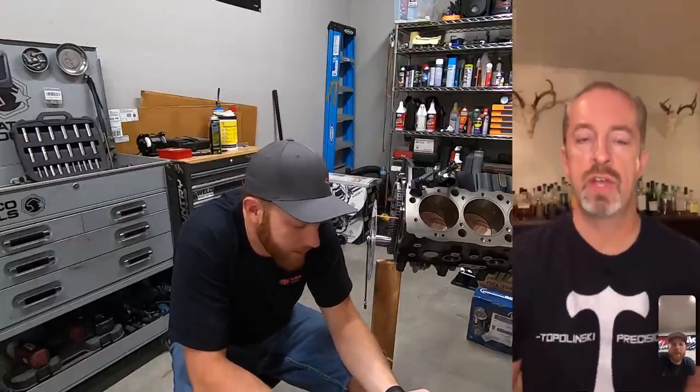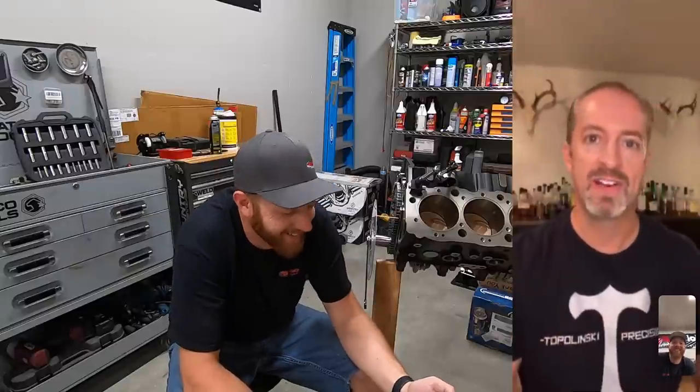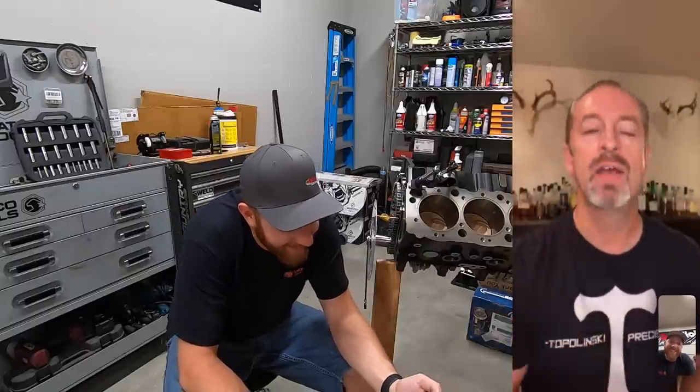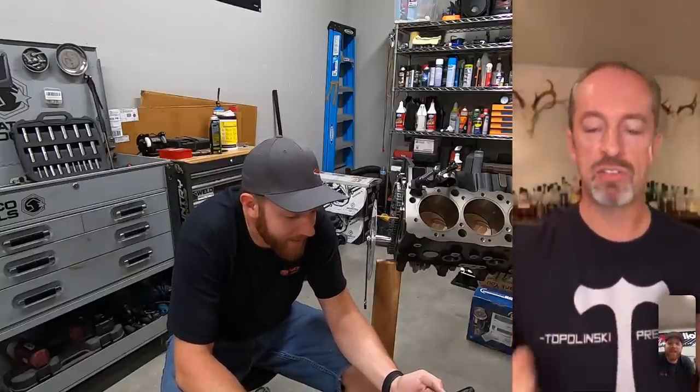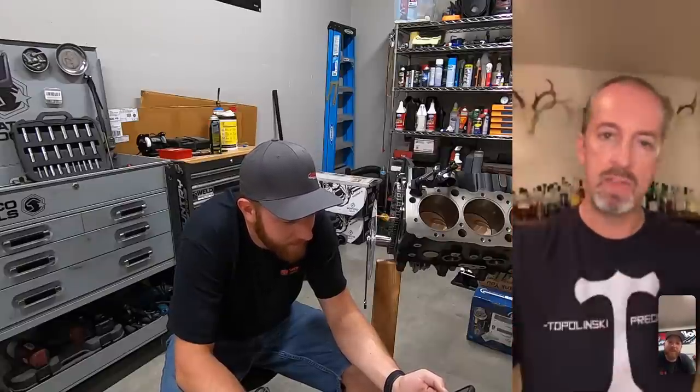So your cam is in 4 degrees advanced. One, let's just back up. I'm very impressed that you checked it. We're gonna start there. And I like that because people think that installing a cam straight up is lining up the dots and going. That couldn't be further from the truth.